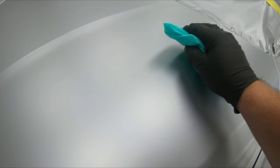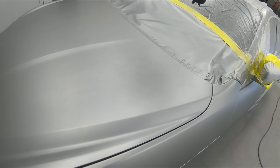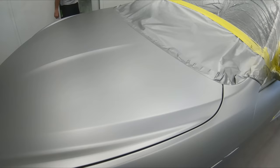We've allowed it to dry. Let's start with the least aggressive method. This is a brand new tack rag. And we can see that our piece of lint is right here. We give it a little bit of a rub down, and we can see that it's pretty much removed. There is a slight etching of the lint still where it used to be. Okay, we can pick that up. But the actual piece of lint is removed. And this is nice and smooth, see no overspray. So what we can do from there is just drop a little bit of paint on it. After that, she's all good.